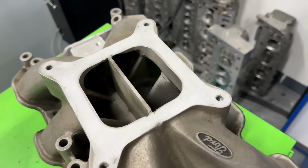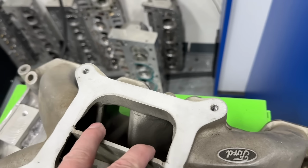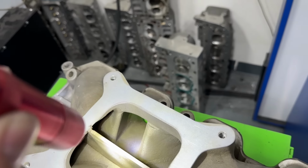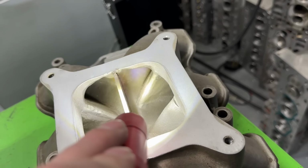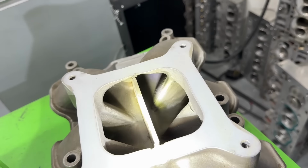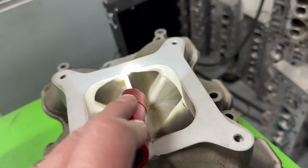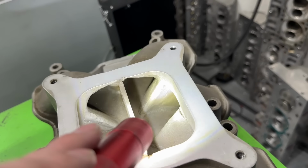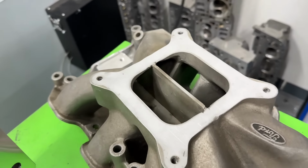You might say, how? Well, on a Ford, it seems like it's even worse. Because these two right here look like you got plenty of airflow. Well, not plenty, but you've got some. But that back one there, your area that's merged is little bitty. Your triangle open window here, see that triangle? It's pretty small. So I don't think it's successful. Feels to me you'd have to port more of the top up here to make this work. You can't just run it like that. And even saying that, I don't like that. But I have never dyno tested it.